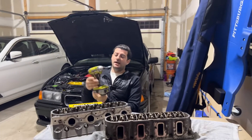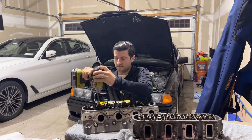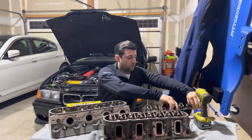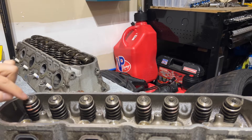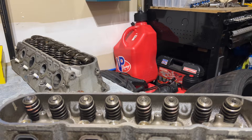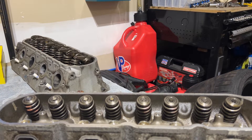The next thing you're going to need is an 8mm to take off the valves. The key is I like to keep everything all together, so I'll move this to the side and get working on the actual valve springs. What you want to be careful of is the keepers — you don't want those flying out and hitting you in the face, so it is good to wear protective goggles. It never hit me in the eye, but it did hit me in the mouth, and you definitely don't want to get hit in the eyeball with this stuff.